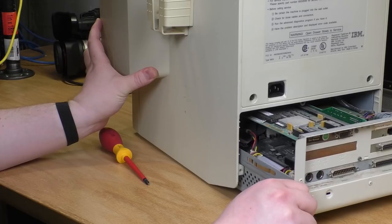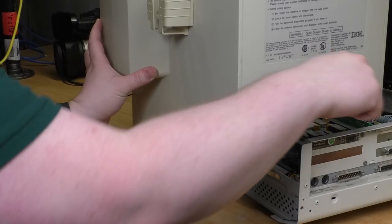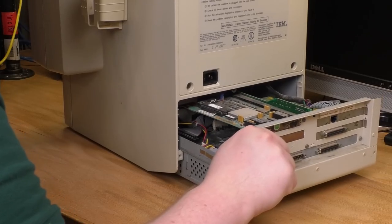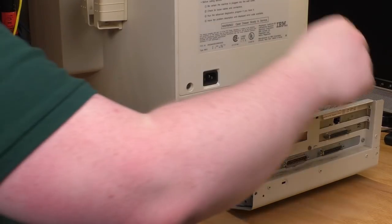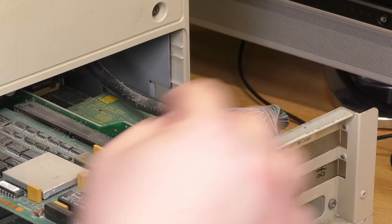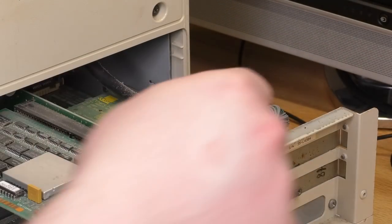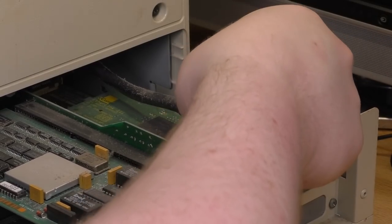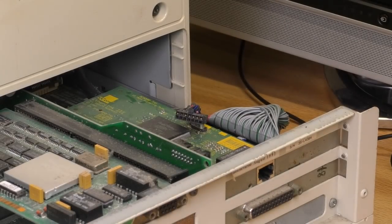Now, there could be cabling going on here, or it could be like quick disconnects or edge connectors or something. I can see a cable starting to go taut here. I'm thinking that's the video cable for the monitor. Yeah, I see red, green, and blue coax wires there. This thing is really heavy. I mean, it's the whole PC I'm pulling out here, but still, it's really heavy. Okay, I'm pretty positive that this cable here needs to go. Let me see if I can get you a better view of that. Yeah, so this cable right here is going pretty taut. I'm positive that's going up to the monitor driver. Is there a release on here? Can you just pull on it? Oh, you just pull on it. Okay. It is keyed, so you can't get it in wrong.